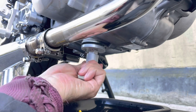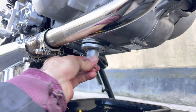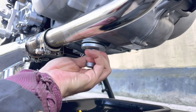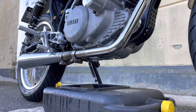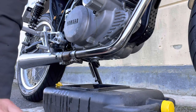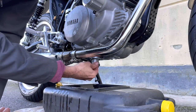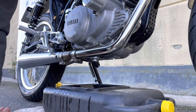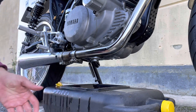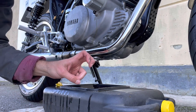And you can get it finger tight if you can, with the wrench or socket, I mean. Yep. Now comes the real advice. When doing this back up, only ever use a socket that is the exact right size, which in this case is 19 millimeters. Don't use any other tool. Preferably, almost a necessity, almost a must, because I've been working on these bikes for a long time and I still don't have the feeling to get this right.